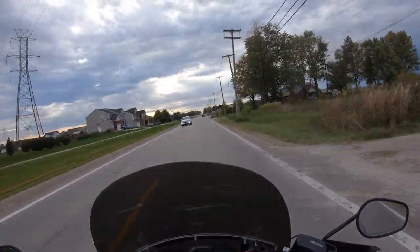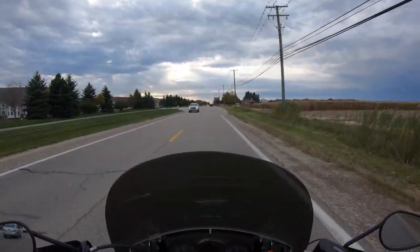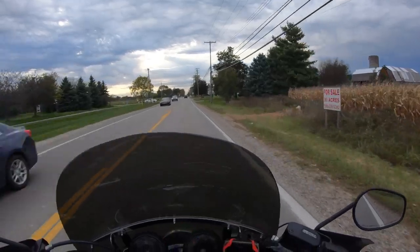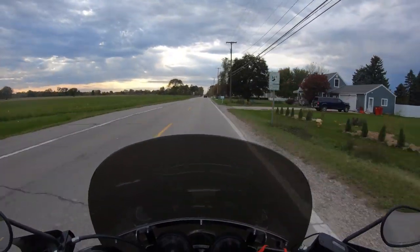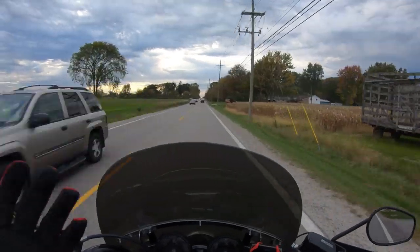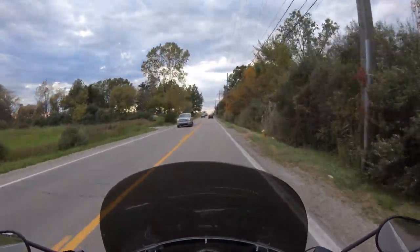It is something that people have been asking questions about. The biggest one I found so far is, why is my Milwaukee 8 sumping oil? Well, there's an easy solution for that. And it's because your motor's not getting enough oil to cycle through it. Problem answered. Why is your Milwaukee 8 touring model sumping? It's because your motor can't get enough oil through it.